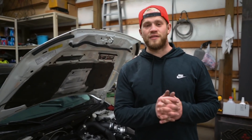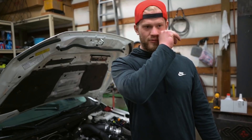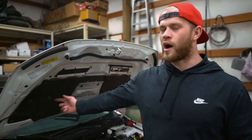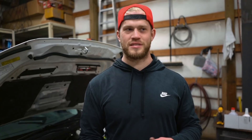Three hours later — I finally figured out what the issue was, and this is the dumbest thing ever. It's always the most simple stuff. I had my brother Austin come over and we started with just the most basic stuff, tracking all the wiring from the ignition all the way down. All it was — there are two wiring connectors that are both the same: one goes to your starter, one goes to your AC pump, and I had those two flipped. That's all it was. Same exact connector. I feel like an idiot, but we got it figured out — the car turns over.